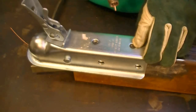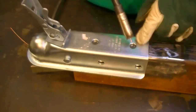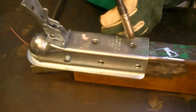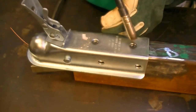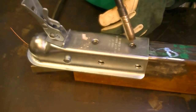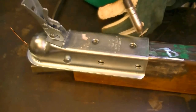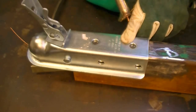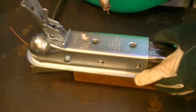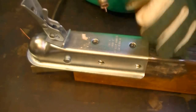With a coupler like this, I tend to start on the top rear hole — there's no particular reason, it's just my method. When you're doing a plug weld, you don't want to start on the edge of the hole trying to weld the top piece to the bottom piece. You actually want to start on the bottom piece in the center and start building your puddle. Then you move the puddle around the edge of the metal until you've welded all the way around that little seam — just a little tiny circular movement. When you get toward the center, you just want to gradually fill it until it's slightly rounded over. You don't want a concave weld — you need a slightly convex or even weld. The top welds and side welds together are going to hold this coupler, along with the seam welded along the bottom edge.